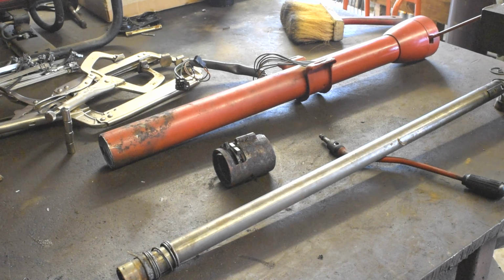I'm trying to show as much of what I'm doing kind of in the middle. So far we've mounted the new gearbox. We had to make some clearance for that on the one motor mount. I'll show you before we put that in for good. And then we cut the end off of the steering column housing, and then we sectioned the actual steering shaft. So new bearings, new stuff on the column, and it'll be back together.